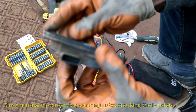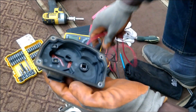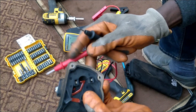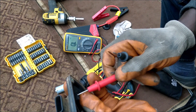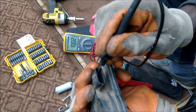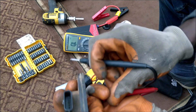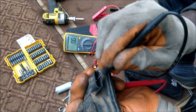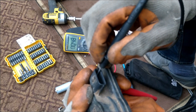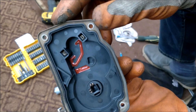The next thing is to check the connectivity between the electrical port here and the components themselves. We're going to use our trusty multimeter and just test the pin out. For the motor feed, if my memory serves me right, it should be the last pin here — yep, that's it. So that's good connectivity. The second leg of the motor connector is just about right. Let's try that first leg again — that is acceptable to me. So it doesn't look like this is the culprit.